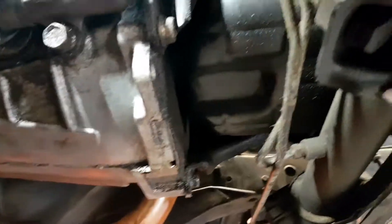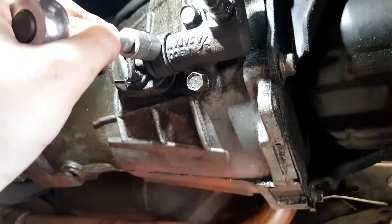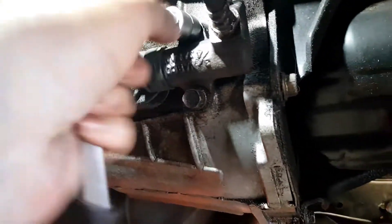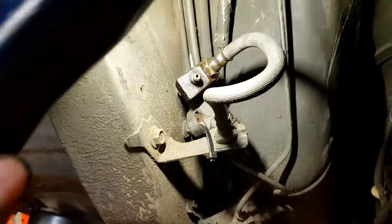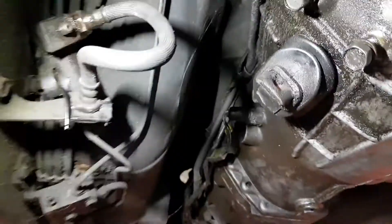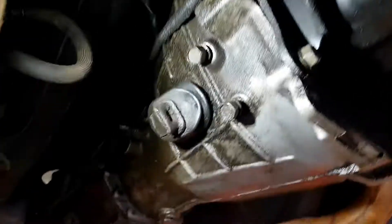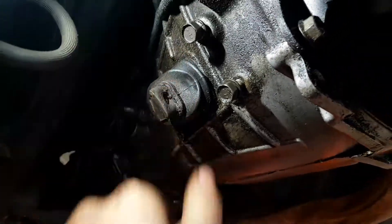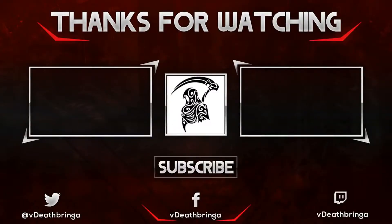So next we're under the car here. Now we're going to take the clutch slave cylinder off here by taking off these two bolts. Just taking that and that off, and then this will come out. So I just hooked it up there with a little zip tie, and this is what it looks like now — we sort of have a push rod. Put it into gear. I've also taken those bolts off as well for the down pipe.